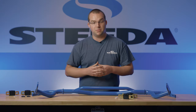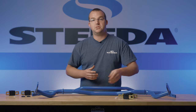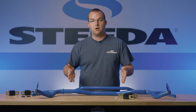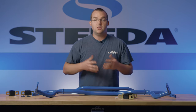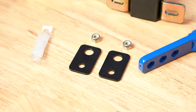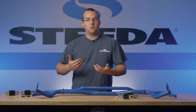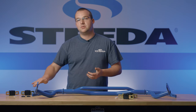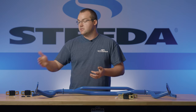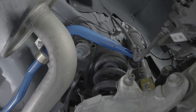Installation for the front bar is pretty straightforward — it's a direct fit replacement for your factory bar and mounts. We include the mount and the bushings that you can use to install this bar, and on top of that we include lifetime grease as well. You reuse the bolts. Now on the rear bar with the three adjustable positions, it takes up a bit more space than a factory bar, so we include an adapter to relocate the brake line bracket, as well as lifetime grease and the mounts with the bushings for an easy installation.